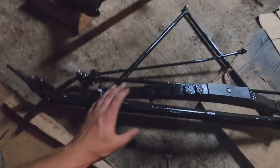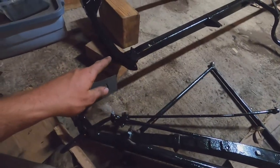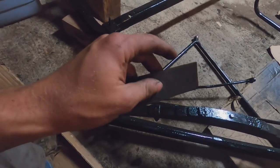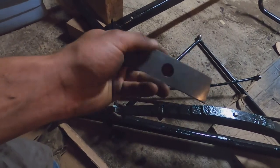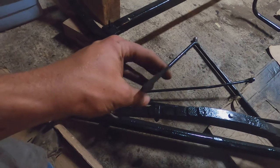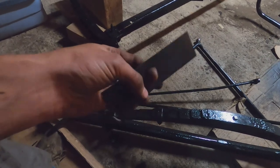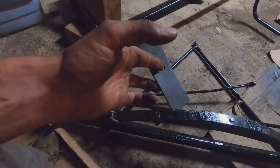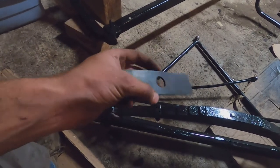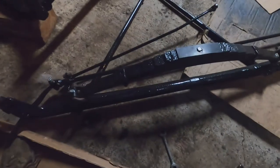Once I do the rest of these oilers, I can put this on the frame. When I attach it, I have a new rubber pad that mounts between the top of the leaf spring and the inner part of the frame where it bolts together. The old one was falling apart with very little left. The first couple of years of Model T's used leather pads, but about halfway through production they changed to rubber. You can use rubber on any year of Model T — it's a lot cheaper than leather ones, and you can't see it anyway. It's just a pad to stop squeaking and make a nice surface joining the two metal pieces together.